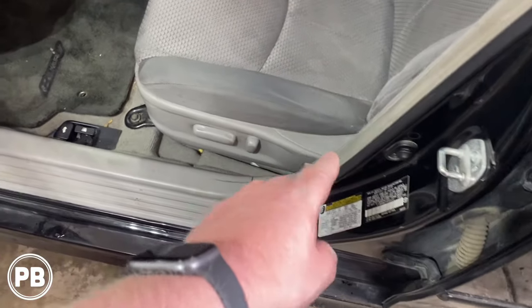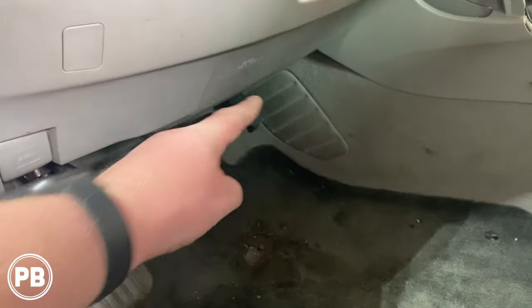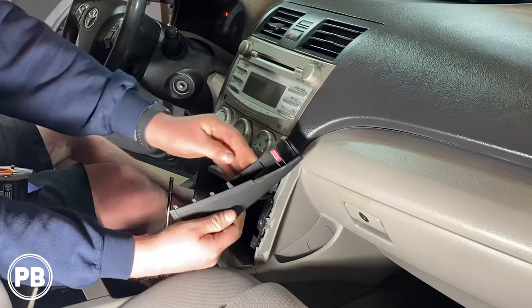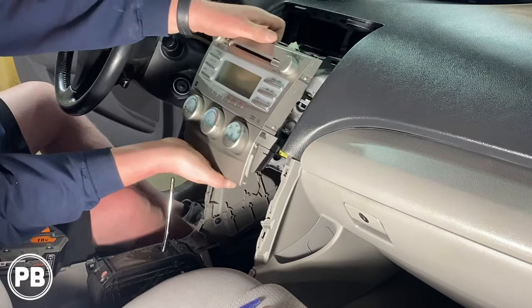Okay, so we continue tucking our wire underneath the panel, working our way forward. We came up this panel, and we went up and over. Now there are places to zip tie it to, up and under the steering column, and into the center console. If you want to see how we took apart this center console, it's pretty straightforward. We go through that in great detail when we install the aftermarket radio.